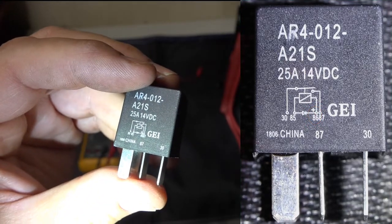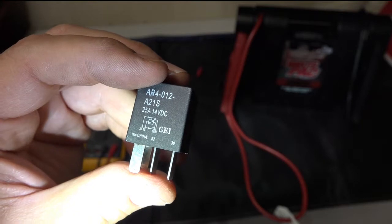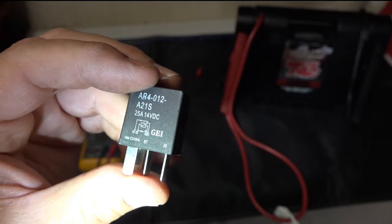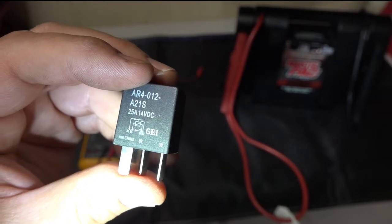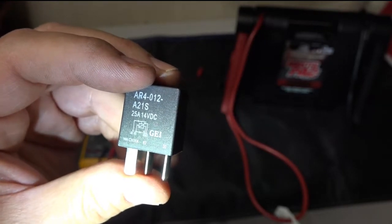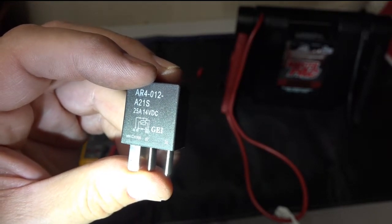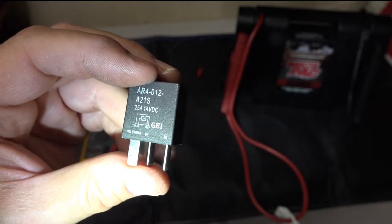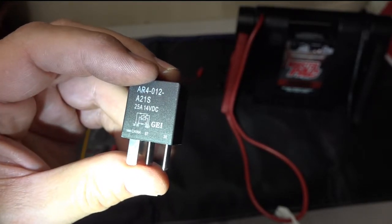It's imperative, if you've got a relay with a spike suppression diode, that you have the polarity correct on terminals 85 and 86. 85 needs to be the ground side. 86 needs to be the positive side. That diode is placed in reverse bias during normal relay operation. If I attempted to put power into 85 and ground on 86, I would forward bias that diode, basically causing a short to occur. And if I've got a computer that's controlling this, there's a good chance that it may damage the driver inside that computer. So we definitely don't want that to happen.